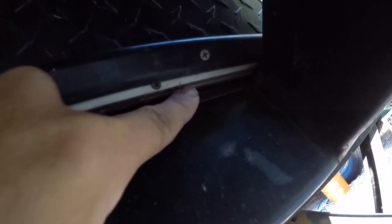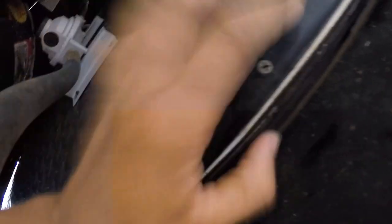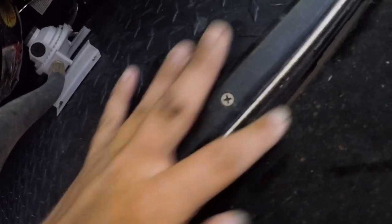I'm going to show you underneath — this is where the rig meets the base shell, basically the floorboard. If you look right along here, the seal has come undone basically through driving. It's along the whole way. What I'm going to do is clean this up, wipe it down, and then reseal it. All Little Guy Max owners need to check underneath here where the floorboard meets the curve of the shell, right underneath the propane tank.